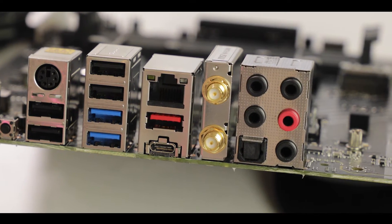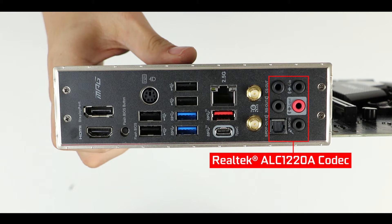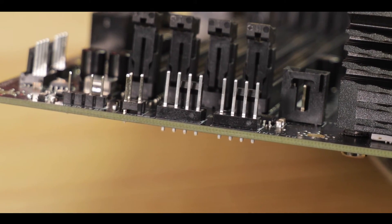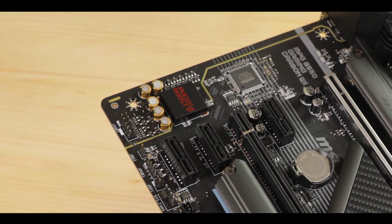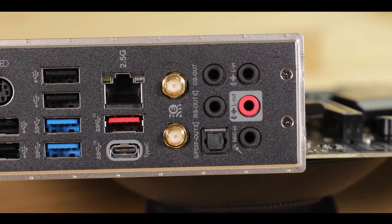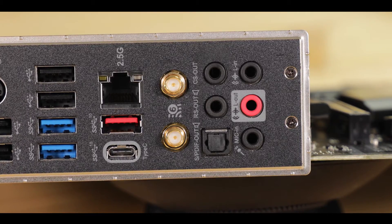We have an excellent AX200 Wi-Fi 6 dual-band module with speeds up to 2.4 gigabits per second — a sizable and long-awaited upgrade compared to its predecessors. Finally, we have the 8-channel ALC1220A audio codec, about the very best integrated audio codec you can have on a motherboard. It takes full benefit from the numerous PCB layers, with both left and right audio channels traced on individual PCB layers for better sound insulation — definitely one of the best integrated audio experiences available, especially useful in non-grounded houses for pure bass in gaming and clean audio when recording.